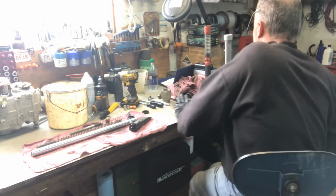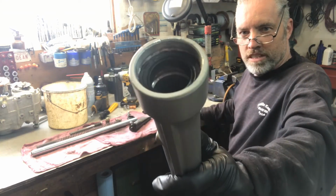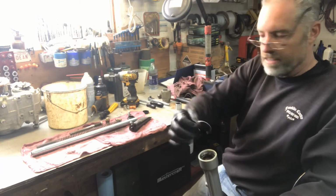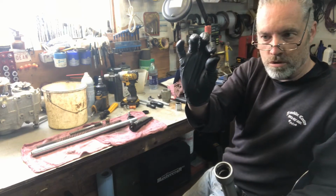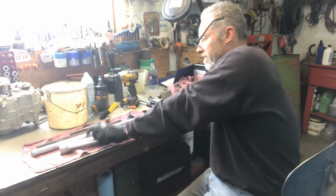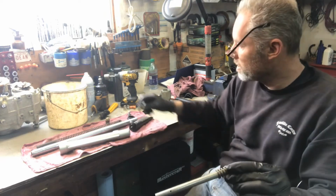So that's in its spot. As you can see, the seal is in there. Around the seal, there should be some type of little ring or groove that you see there. That is where this circlip fits in to hold everything into place. Plus the bolt that I had mentioned to you earlier, 6mm Allen, 8mm thread, which screws into the bottom of the fork. Because your damper is in the fork, this screws into the bottom of this and it holds both items together.